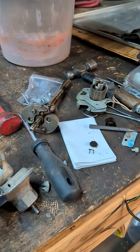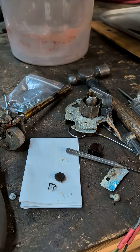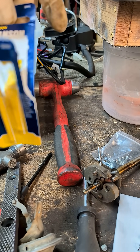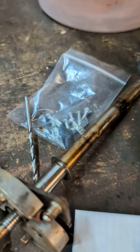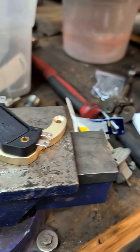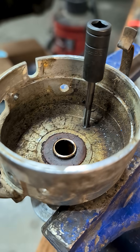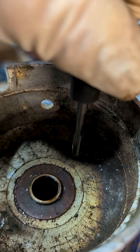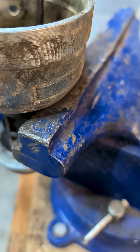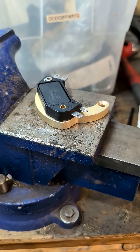Taking the distributor apart — I'm not going to show that, there's plenty of videos online about doing that. But you do need a 10-32 tap, and it does come with the hardware. All you got to do is pull the shaft and the turn plates and everything out. The hole's already the right size pretty much, and then you just got to drive your tap through there, clean up the frame, and bolt on your HEI module and stick the whole thing back together.